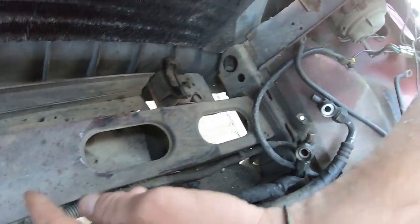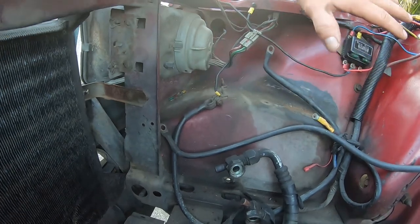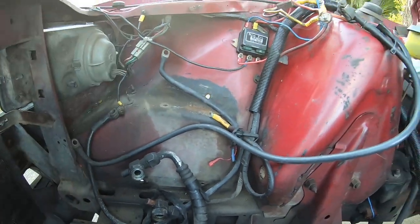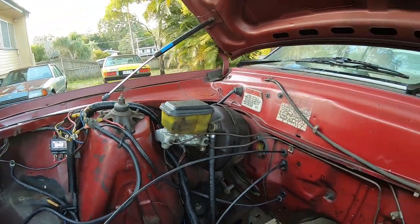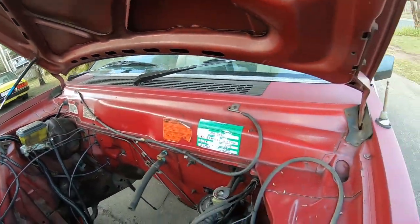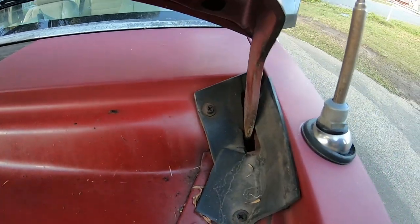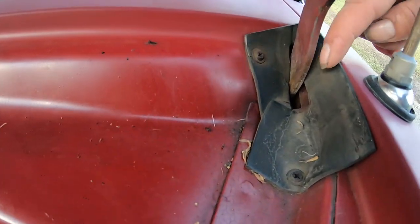Check these corners — this all looks like original spot-welds. Also get your head right down, checking underneath where they can rust out around the radiator brackets and around the front torque boxes. You've checked already from the bottom, now you're checking from the top, and then you can almost check off in your mind — under the battery tray, this area — that it's been systematically checked. It's all quite good.